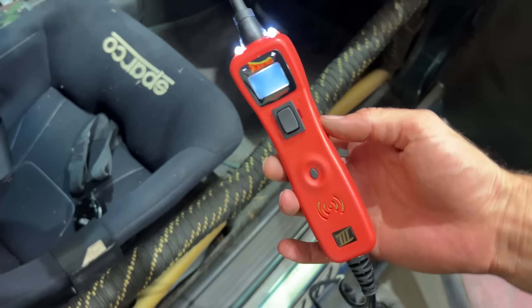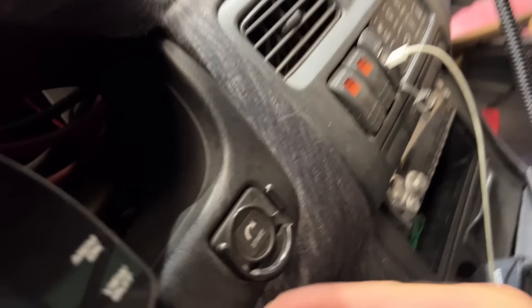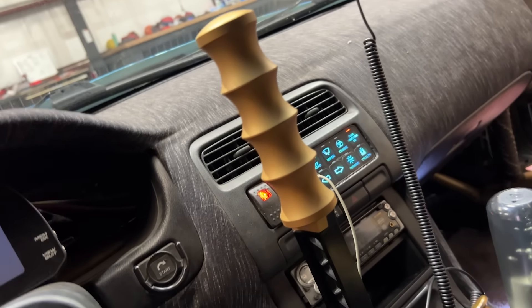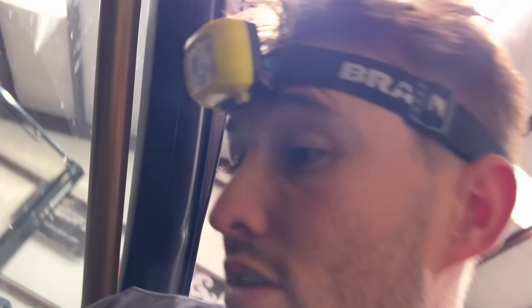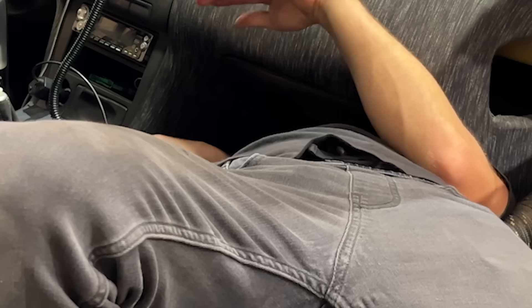This is the best tool ever — it's called a power probe and I use it for so many things. We're going to use it to find out where to plug in the AFR gauge. What we're going to do is turn the key on, touch everything to find what's on, then turn it off to make sure the thing with power turns on and off by the ignition switch. So now I'm just going to go digging. Ow, my body, it hurts — I'm all contorted in here.